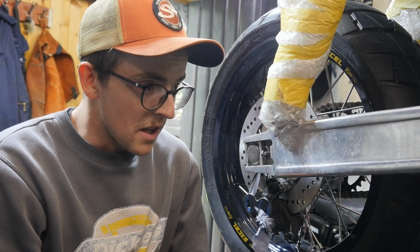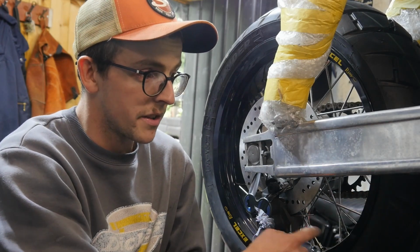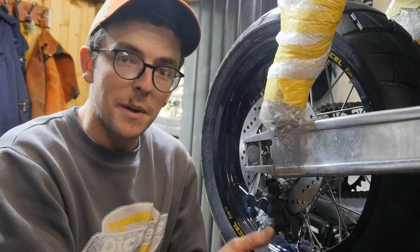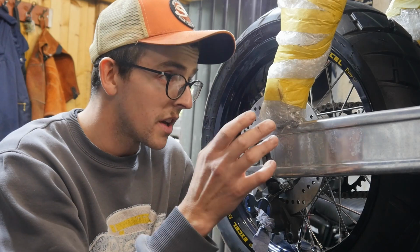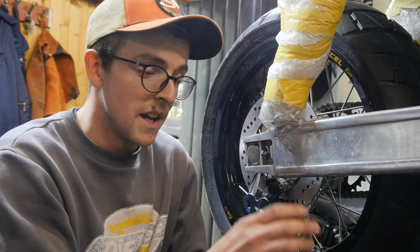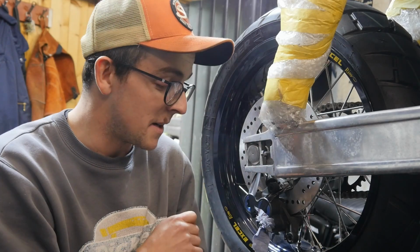And then I can also think about a torque arm I need to pick up from the bracket on the swing arm here and come in to prevent the thing rotating. It's a fairly standard way of mounting a back brake on a bike, to have a caliper hanger and all that. It's just that this is completely custom to this bike, because the other caliper hanger is not going to work, and custom discs just aren't an option. Hideously expensive, basically. So I'm going to try and use the Brembo discs I bought initially.